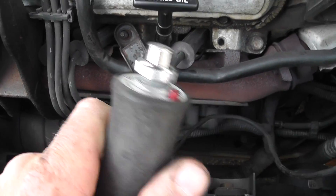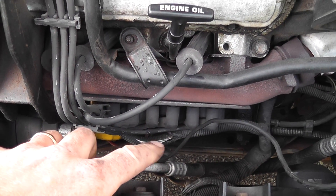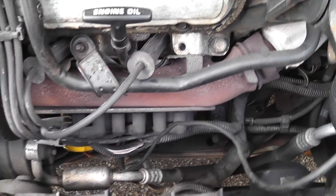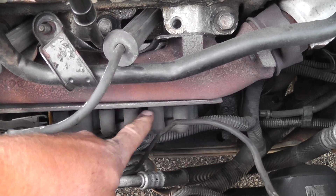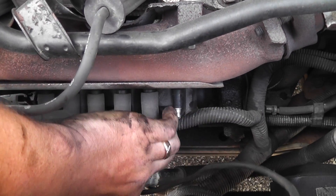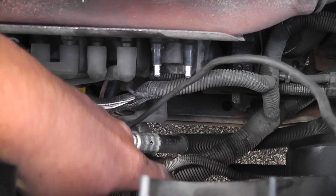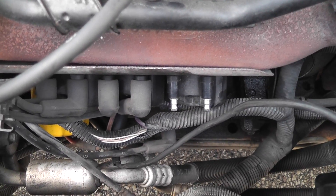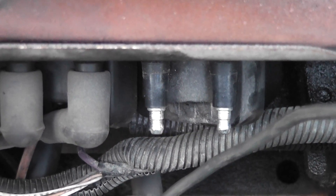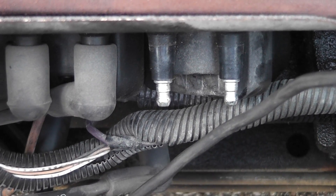I have the key on right now because I need power to my ignition system, injection system, and the computer. I have one end rigged to the starter S post — that's the solenoid wire — and the other end going right to battery positive. On this design with these three individual coil packs, I'm just going to pop these plug wires off of one of the end coils. Nice thing about a waste spark is it really doesn't matter how you put them back on as long as they go on the same coil. When I crank this engine over, I want to see spark jump between this tower — and there it is. You can see clearly this engine has spark.